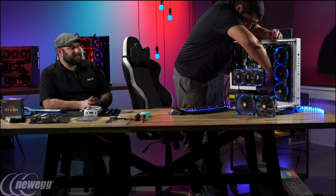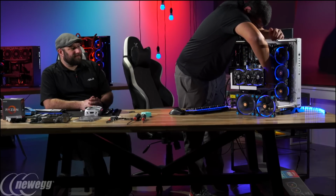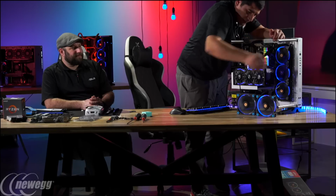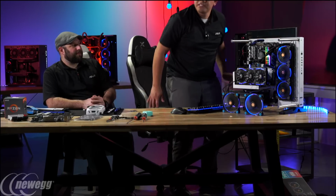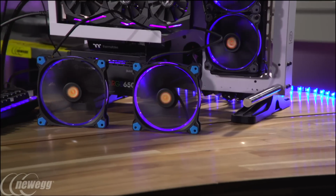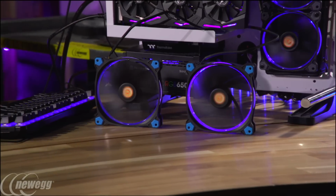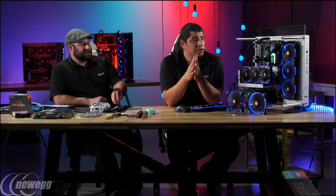Hey, JJ, can you address the RAM issue again? Some people online are having problems with RAM that's going above, say, 2100 speeds. So yeah, I think maybe after we do this overclocking, we can show people exactly a demonstration of how overclocking can work on AMD-enabled systems for Ryzen specifically. But again, to give you guys context, if you're going to be running 2 DIMM channel configurations, the board can fully support up to 3200 megahertz. Okay, so just with 2 DIMMs in there.